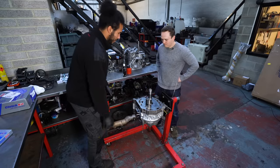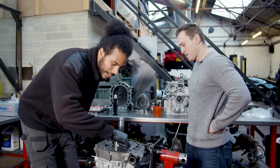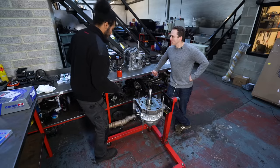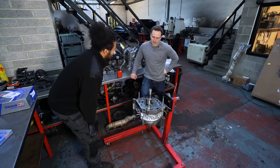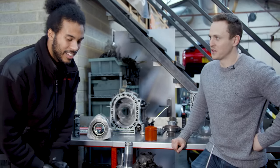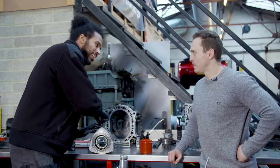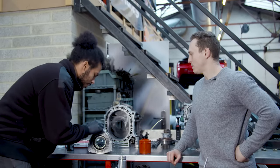Once again, same process — start with the assembly lube. Make note when applying assembly lube to the irons: make sure it doesn't go onto the water channels. More dowels, more lube on the dowel. You'll have to make note of which direction your rotor is pointing underneath, because that determines how the opposite rotor is going to face. It's a nice simple engine to work on — there's no cam hits or anything like that. There's plenty of enthusiasts that enjoy doing little home builds. The experience comes from clearancing and things like that — not everyone knows how to use a feeler gauge, and there are varied opinions on how to use them. We've built enough engines now to know what fits best and what clearance to go for depending on the application, not just with RX-8s but with RX-7s as well.